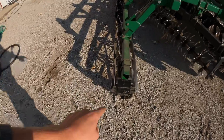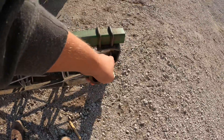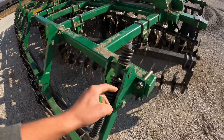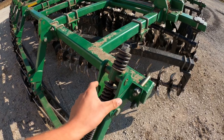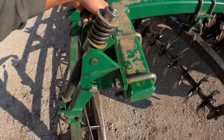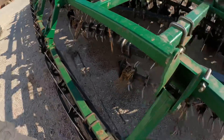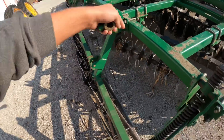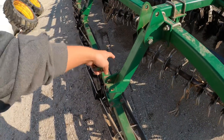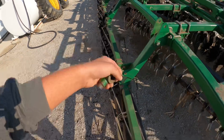It's not going to be perfect, but we'll be able to get across what we need to get across. We'll have to get a new bracket — another new bracket down there — and possibly a new housing for that bearing. The issue is you can't just buy this piece; you can't spread these brackets apart to slide this piece in. It actually cracked the welds, as you can see there and there. So really we need three new brackets, six U-bolts, and replace that. We've got the whole spring assembly in the shop, but this will get us by.